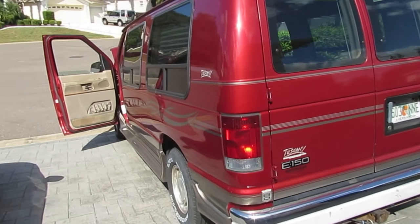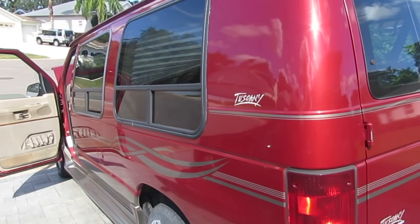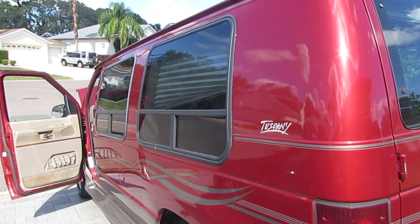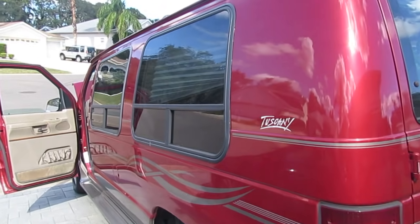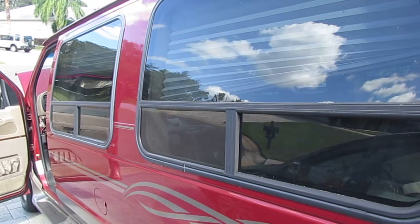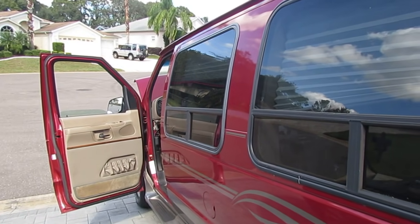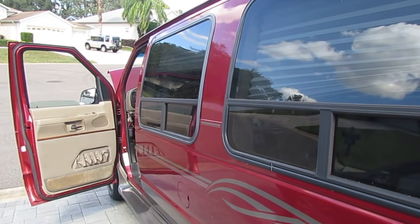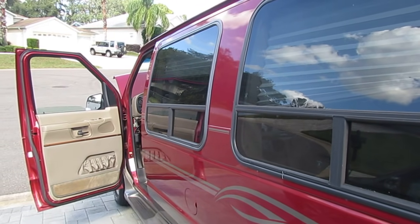About a week ago I jumped into my van and lo and behold the air conditioner's on but everything's blowing out the defrost duct. I've known this for years, but if you lose vacuum these systems default to defrost. So I knew it was a vacuum problem, so I went on YouTube, found a couple of videos, and sure enough I probably have the same problem they did.